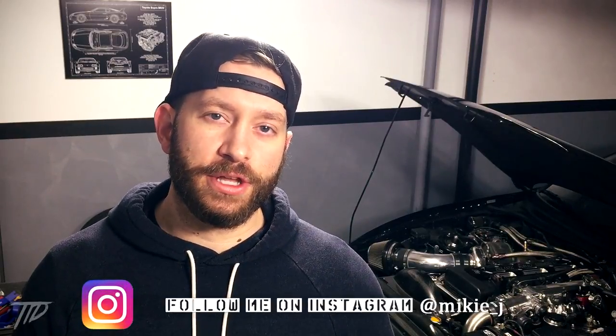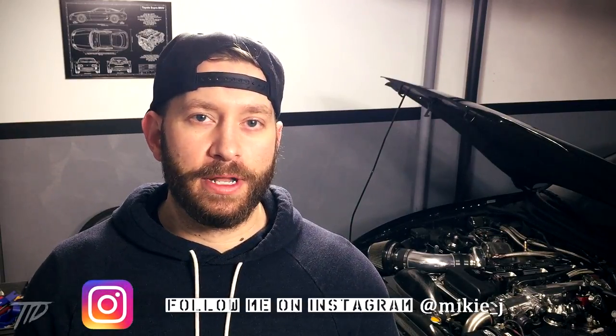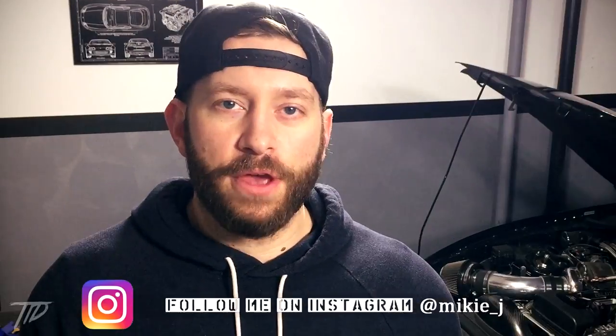Does your car sound like this? If so, you likely have an aftermarket clutch that removed the dual-mass flywheel and exchanged it for a single-mass flywheel. The OEM flywheel of a Toyota Supra was a dual-mass design, and with this design it can dampen all the vibration from the engine and prevent those vibrations from being transmitted through the rest of the drivetrain.